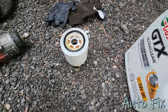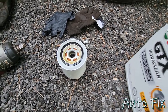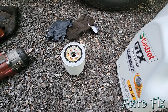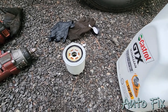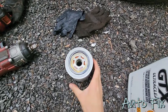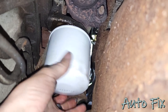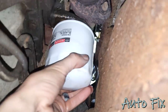The first time I took the filter off — when I first bought the truck — I used big pipe wrenches to take it off because whoever tightened it made it extremely tight. Obviously if you have to do that it is way too tight. You should be able to do it by hand or with minimal effort with an oil filter wrench — it should not require a foot-long pipe wrench. When installing, sometimes it's a little tricky to get it started on the threads, but once it starts you should be able to easily spin it. If it's not easy to spin it's probably cross-threading, and you should back it off and try again.